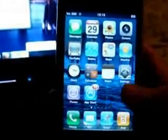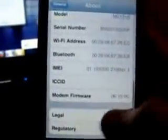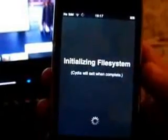It's all done. When it says don't interrupt flashing baseband, that does take a couple of minutes, and it will flash straight to the Apple logo and then kick you back to the home screen. Go to Settings > General > About — I'm still on 4.2.1 as I started, but my modem firmware baseband is now 06.15, which is unlockable. Now go into Cydia — don't worry if your Cydia icon is white, once we do the reboot it will show its true app color.